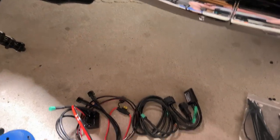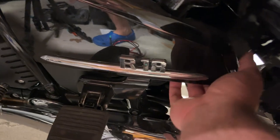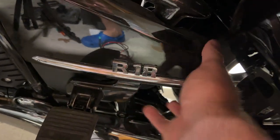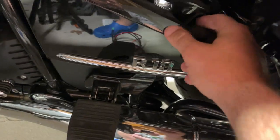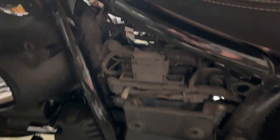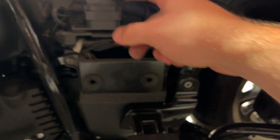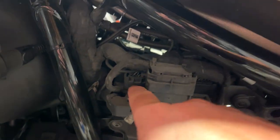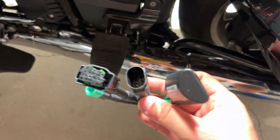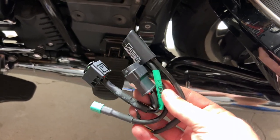The way the can opener goes on this bike is you're going to drop this peg down like that, then pull — the grommet also came out by the way — and pull that out from that little hook. The rest of these are all grommeted in, and as usual one grommet goes with you, so put that back in before you reinstall everything. Underneath we're looking for the alarm cable. The OBD2 port is there, and I think the alarm cable is right there. I'll unhook that, plug the can opener into it, and the other alarm cable goes back into the other side.